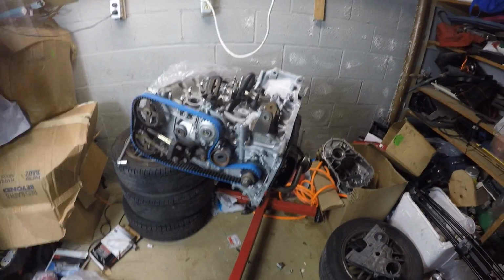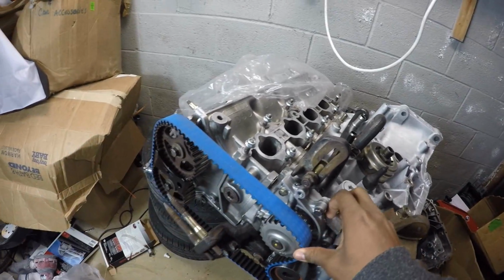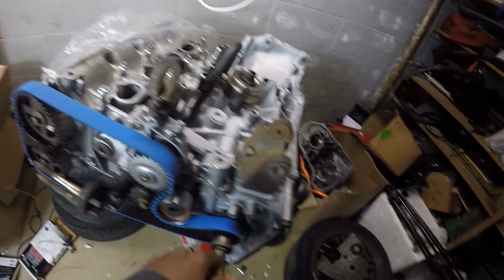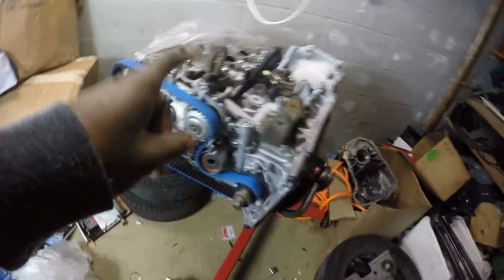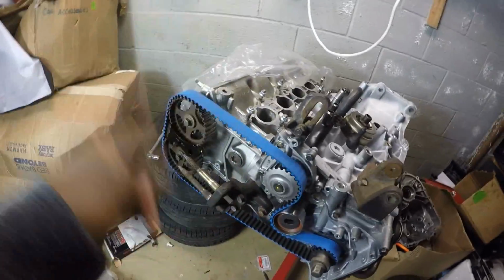So basically what happened was, the timing belt was on, as you saw by my Instagram picture. The timing belt was on, and then I rotated it back 3 teeth counterclockwise. I don't know why nobody ever says this, so I'm gonna say it right now. When you're doing timing belts on a B series engine, or mainly old 90s Honda engines, they rotate counterclockwise. Nobody told me that.